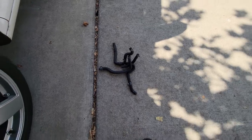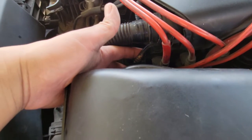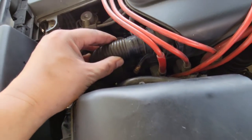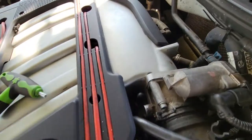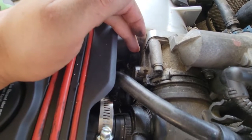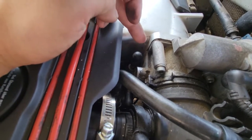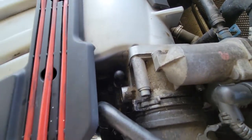Just finished up. While I was taking out all the extra hoses and trying to take off this little metal bracket — which has the metal routing for the throttle body flow — that bracket actually holds in a lot of other stuff. It was holding the EVAP system hoses and such, so I decided to keep it in. I also checked inside the throttle body and it looks pretty gunked up, so I'm going to plan to clean the throttle body plate and the coolant flow portion too.